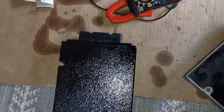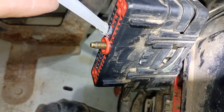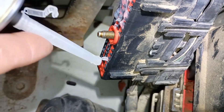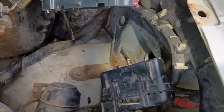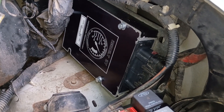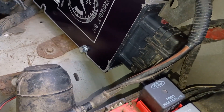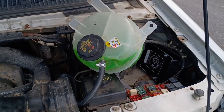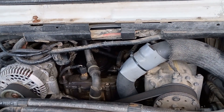No question in my mind that there are some significant issues with this old IDM. I'm really hopeful that plugging this new one in will solve my problems. Before I plug this in, I'm just going to put a little bit of dielectric grease on the connector — I cleaned this yesterday with deoxit, so this should make sure the connections are all good and will stay that way. Putting in the new IDM is a simple matter. I'm going to plug this in here and then bolt it down to its housing. New IDM, all bolted in — this time with three bolts, as opposed to the one that was barely holding it in before, and the plug is tightened up.